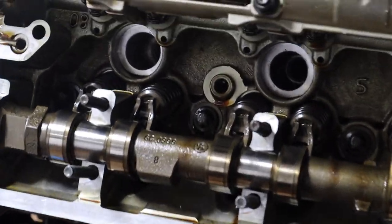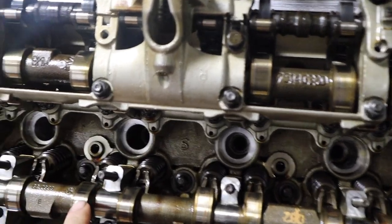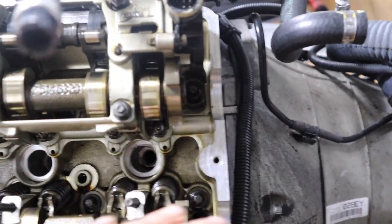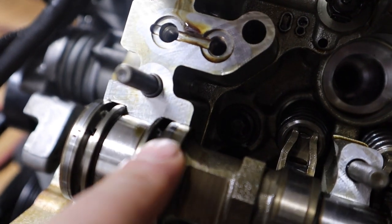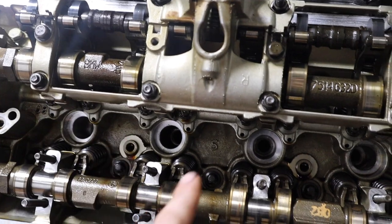All right guys, so what you wanna do, make sure this is cylinder 5, right? Not the first but the second one, that's cylinder 5. These lobes are facing up, because that way they're not pushing against the rockers. It sits flush. When you put the caps on, again, make sure these rings are closed like this. See, they're locked. I did put some engine oil, or whatever lubrication you use, then put the caps in order. They have numbers on them.